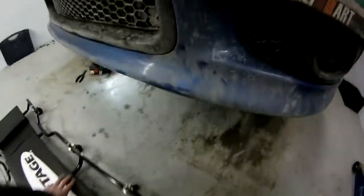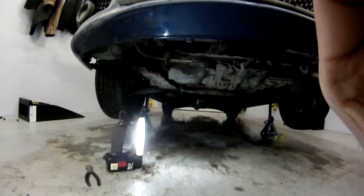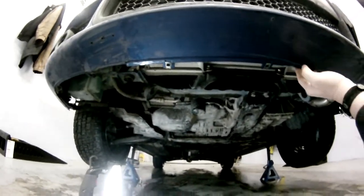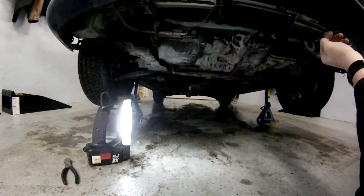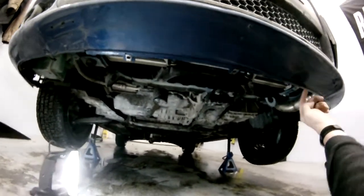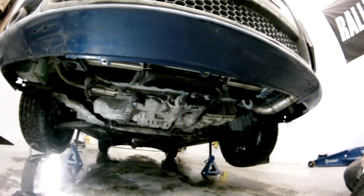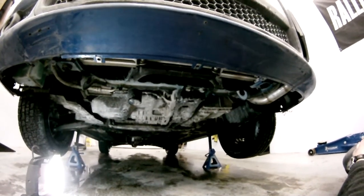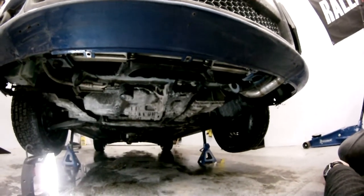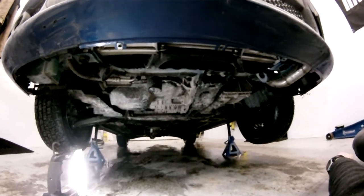I'm just going to throw this down, take a quick look underneath the car here, get down on the creeper. As you can probably see, we don't really have much protection right now, and things have gotten pretty muddy just with the plastic in there. Looking down the undercarriage, you can see all the grass and mud still stuck there. The idea is to have something that follows the actual line of the front end, use the existing clips, and maybe fabricate a couple additional mounting locations to stiffen it up and provide additional protection. Maybe put a couple slots in it for venting because the transmission on this car tends to be very temperamental and overheat almost every time we take it out.